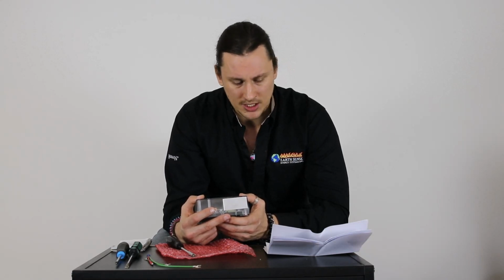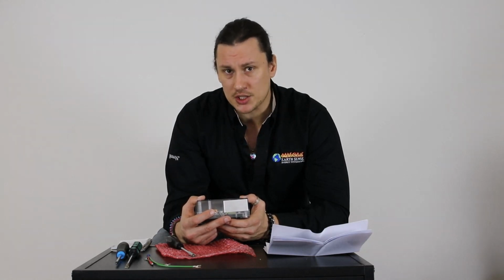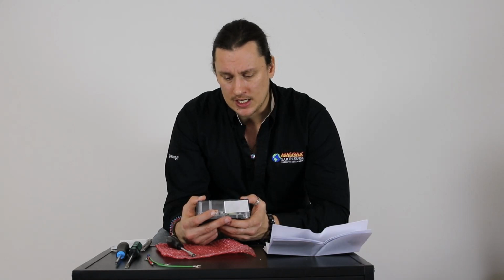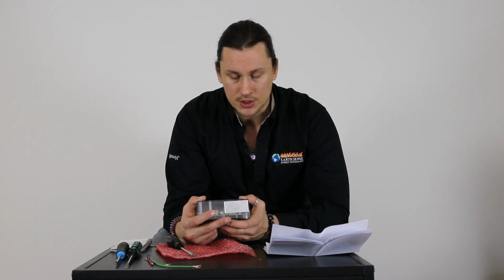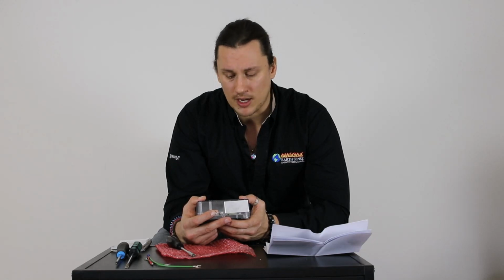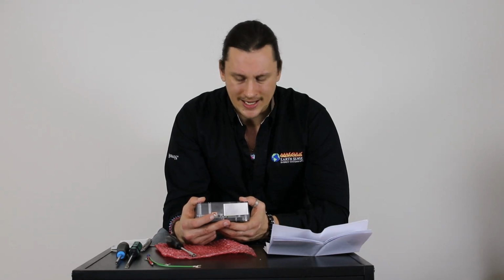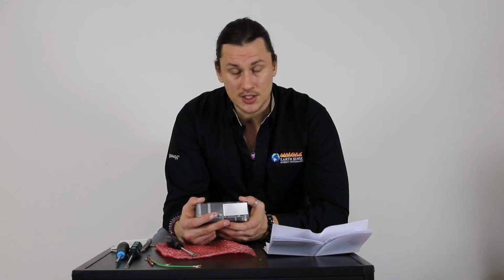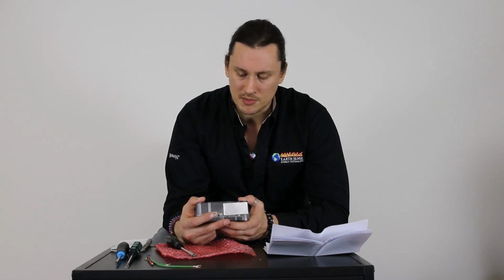So the increase of 10% is actually with the fuel feed in the unit. For the most part, the normal settings are correct and where this needs to be. However, sometimes folks will find an issue, or maybe they're burning a particular pellet that's denser than others, maybe it's longer than others, and they want more fuel to be feeding into that fire pot. So that is essentially the +10 adjustment that I can make for any one of those models that this fits, is to increase that rate of feed by 10%. Again, average pellets, average installations, scenarios, you're going to want to leave that at just the standard setting. But you do have some adjustment there.